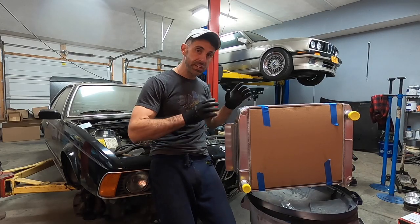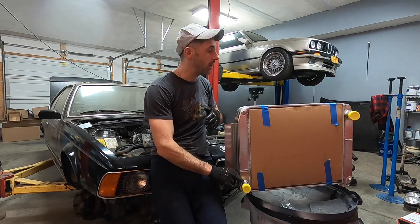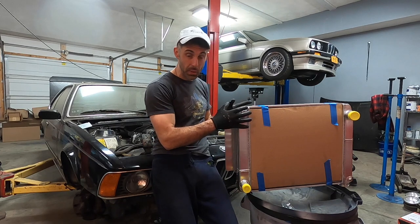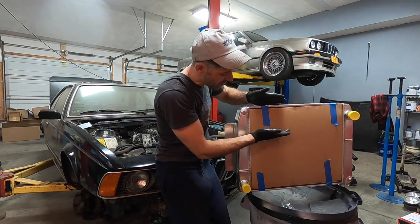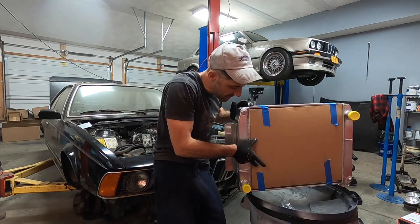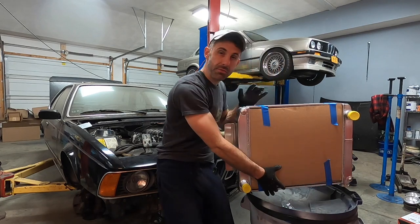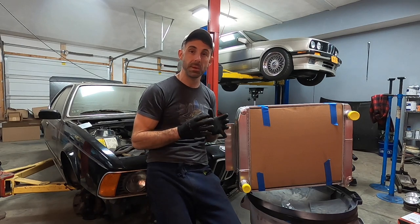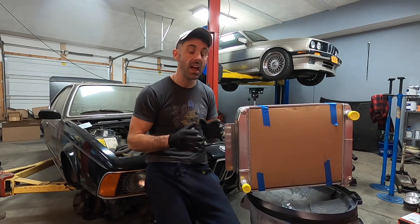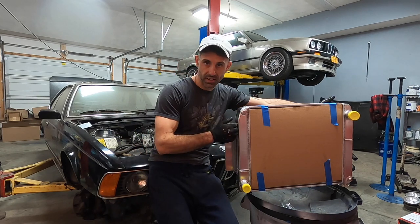What we've got here is an Eastwood tri-flow radiator, basically the Chrysler-Ford style, which has the inlet up top and the outlet down below. This works perfect for our LT1 application. It's over two inches thick and it's a tri-flow radiator, meaning the hot coolant comes in on the first top third, goes through the header tank, routes through again for a second pass through the core, then comes down and passes through the radiator a third time where it exits the cold side. This has been proven to reduce engine temperatures by up to 20 degrees. The inlet outlets are on the right side for the LT1, and it is the perfect overall width to fit within the frame rails of the E24 without many modifications.